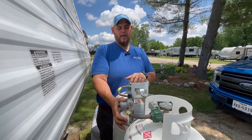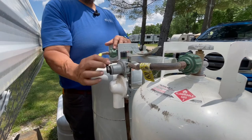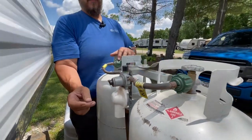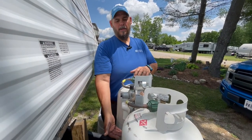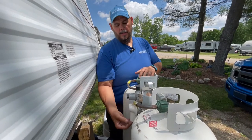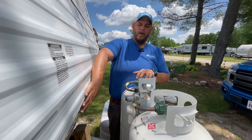The switch is located on their vertical gas regulator, which is what this is — it's a gas regulator. It has the supply side, a center supply position, a cover over the regulator, and a vent that goes in the downward position. This is all required by law. The reason it vents downward is that propane is heavier than air, so venting upward would do no good. This lets it exhaust out as fast as possible at ground level so the propane doesn't find a way into the coach or travel trailer.